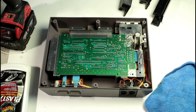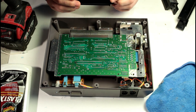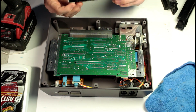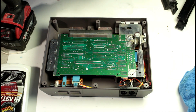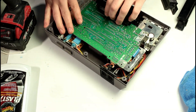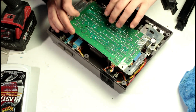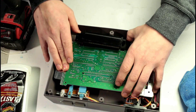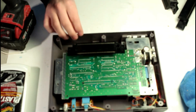Now it is time for reassembly, which is pretty easy — it's essentially just the deconstruction but in reverse. The main thing you want to make sure you do is when we put the main cartridge insert back on: one, get the pin connector the right way. You want the shorter side down so that the screw holes are flush with the motherboard. Then when we put the actual slot for the cartridge back on, you want to make sure that the flap underneath grabs the front part of the motherboard. Lift the motherboard up a little bit, slide this thing on — it takes a little bit of pressure and tinkering to get it on. Push it from the back, slide it on and you'll hear it bottom out.